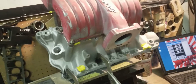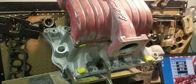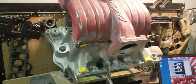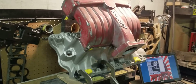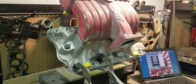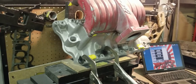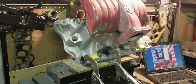You're looking at about 195 to 200 CFM average runner, which is horrible for this setup. Realistically, a cleaned-up GT40 manifold — our Stage 2 GT40 manifolds — would decimate this. You're looking at anywhere from 270 to 280 on our Stage 2 GT40 manifolds, and that includes the Explorer, the Tubular, and the Cobra. Even our Stage 2 351 truck manifold average runner flow is about 235 to 240 CFM.